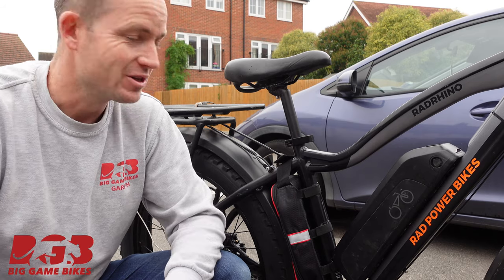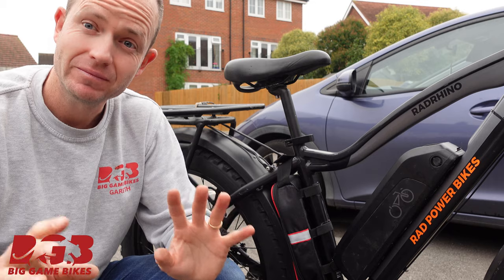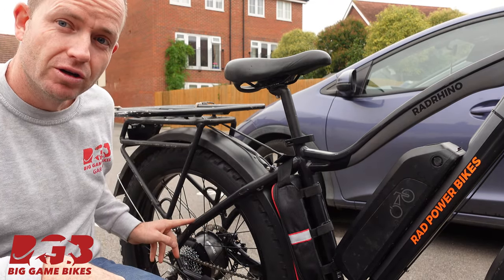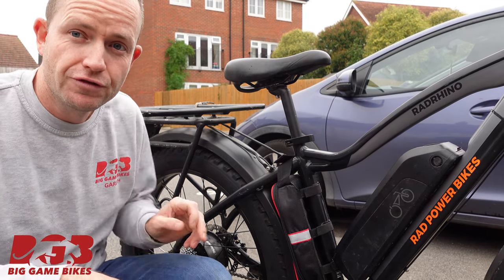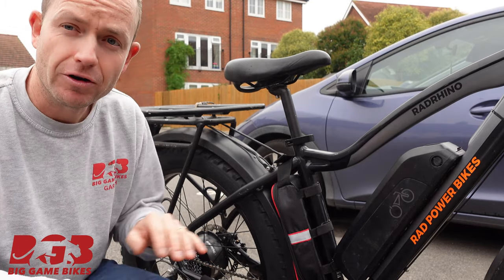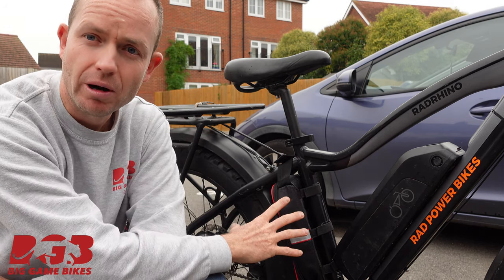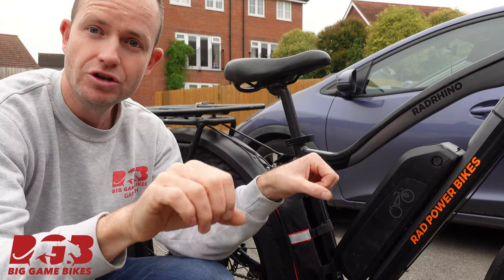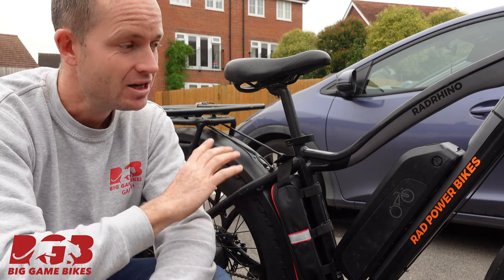We're all done — this build has been a great deal of fun. Let's quickly recap everything we did: take off the tire, inner tube, and rotor, put those onto the new rim and motor, add a new cassette, adjust the derailleur, remove the original controller, pop the new controller on, remove everything from the handlebars, fit the new display and new grips. We also upgraded to hydraulic brakes on this bicycle at the same time.